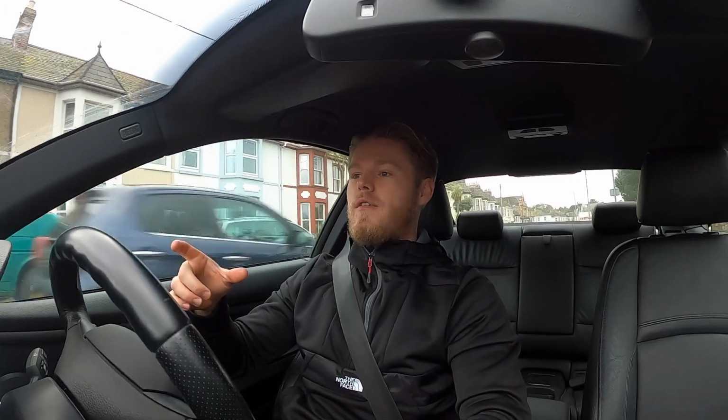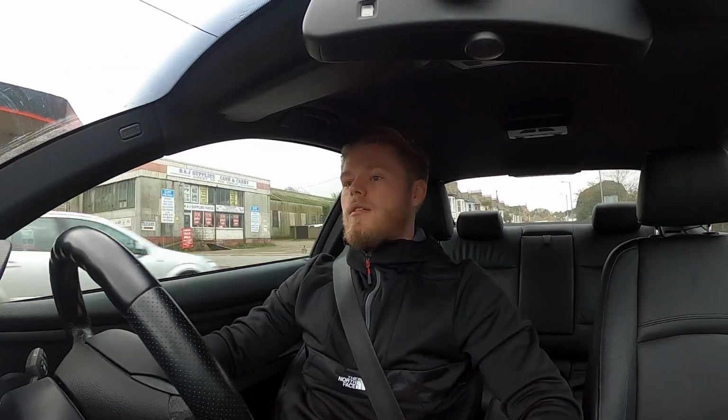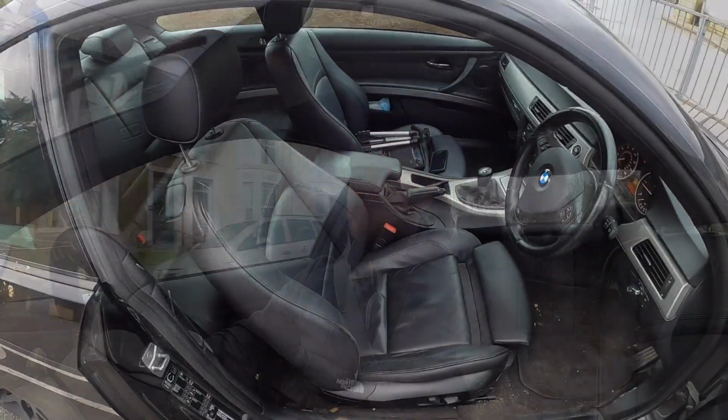As much as that's pretty cool, after quite a while in use of the car, the arm softens the seatbelt material and causes it to have a bit of concave in it, if you like, and it rounds it slightly. So that arm that's meant to push the seatbelt doesn't have enough force because the rigidity of the seatbelt itself has gone. And I'll demonstrate that for you now.